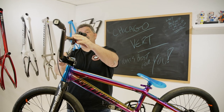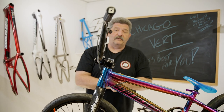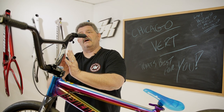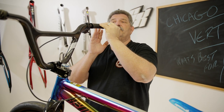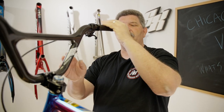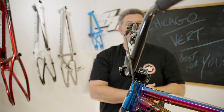When I used to race back in the day, I would always keep it about vertical — old school style. Part of the reason for that was back then we didn't have a lot of frames with a proper top tube length, so we were always trying to get as much extension as possible, running as long a stem as we could and pushing bars as far forward as possible. The bars back in the day had a different bend and sweep that would allow them to be pulled back and be level. Once we started doing the 21 and a quarter top tube, we were able to bring the bars back in line with the head tube, which is the best setup.